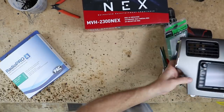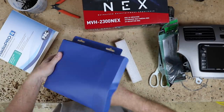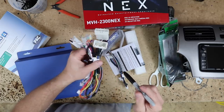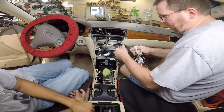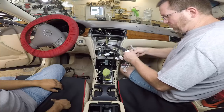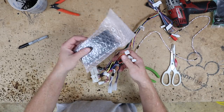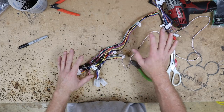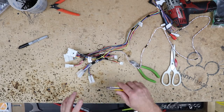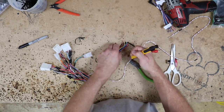So we got the radio out of the dash. We'll go ahead and take that apart in a minute. What we want to do now is get this out of the box and figure out which one of the many harnesses we're going to be using in this car. It's got a lot of harnesses. What we like to do is take our Sharpie, get this into the car, mark up which harness we're actually going to use, and go ahead and plug everything in. Out of all these harnesses, we're just going to be using these two. Let's get it over to the bench and remove all the others. You can go ahead and just plug this in, plug in the brain, and be done with it. You don't have to do anything to the harness if you don't want to. Personally, I like to pull all this stuff off — it just looks nicer, and it gives me peace of mind.